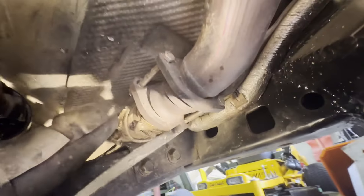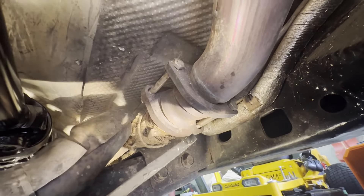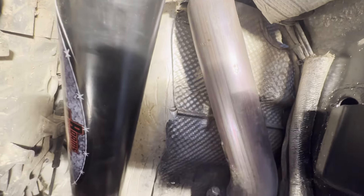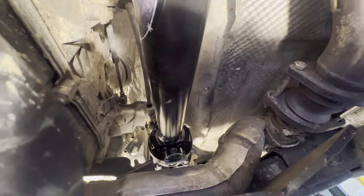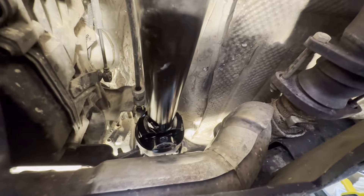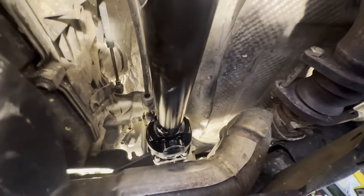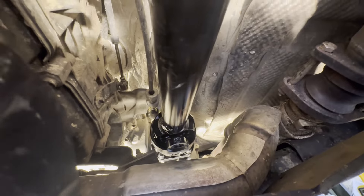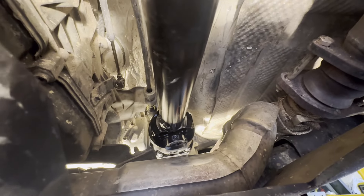I run the exhaust spacers but I'm not going to remove them and bring the exhaust forward — too much work, too much aggravation. You can see I have the loop delete; it goes right into the catalytic converter. Front drive shaft is installed. I'm going to drain the transfer case fluid — the ATF+4 — get that out of there, put some new Mopar transfer case fluid in, and then get this belly armor back installed.